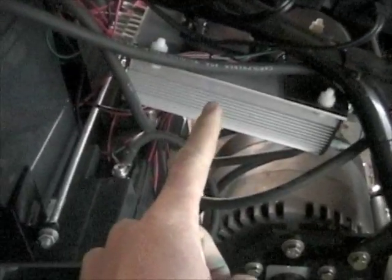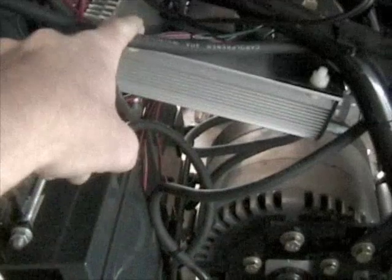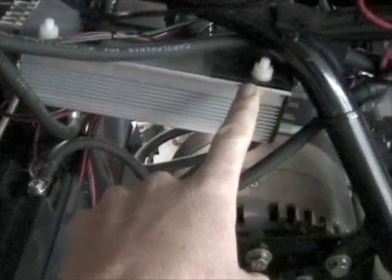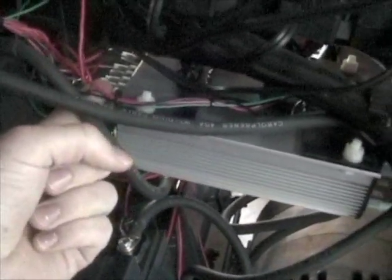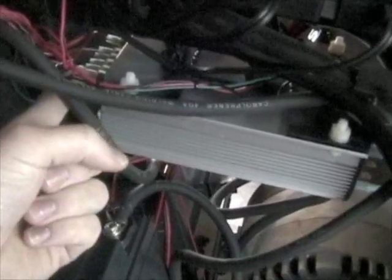Here's the Kelly controller, mounted upside down to a plate that I added to the frame — you can either weld it or screw it on. I used plastic screws to insulate the controller from the frame, and then I had to put little washers as spacers in there. Back here you can see the connections to the controller, including the throttles for the regen and positive acceleration. That's all in the wiring diagram.